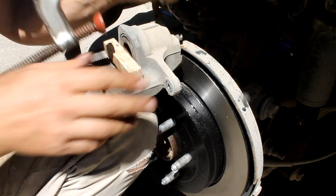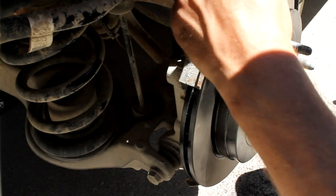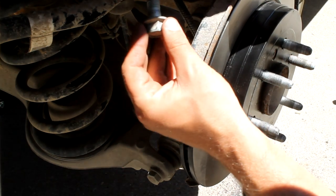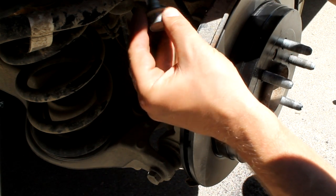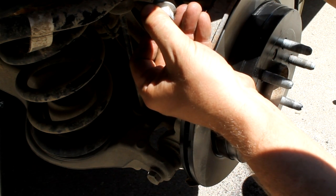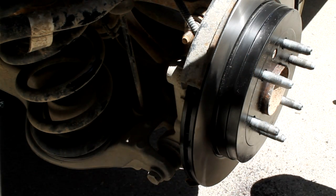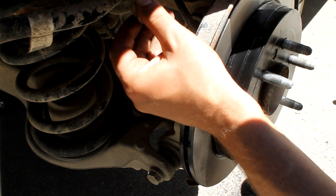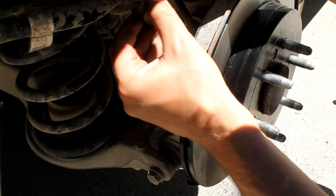And that's it. Alright, so on these 21 millimeter bolts here, this is where we use thread sealant, thread locker. Just put a little bit, ooh, it's hot, that stuff is thin. Just put a little bit on the bolts here. That's one of the reasons why these are a little harder to get off, because they generally have a thread locker on them. So get those prepped and ready here. We're gonna put our bracket back on, and then the caliper will go on after that.